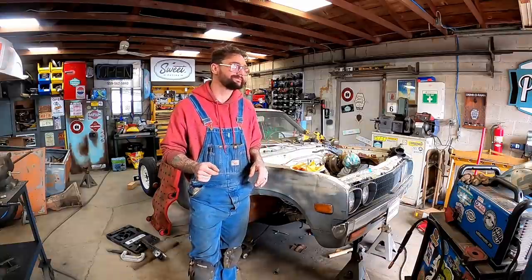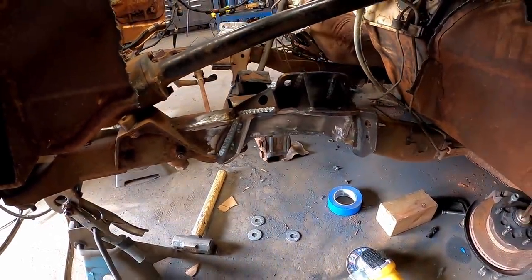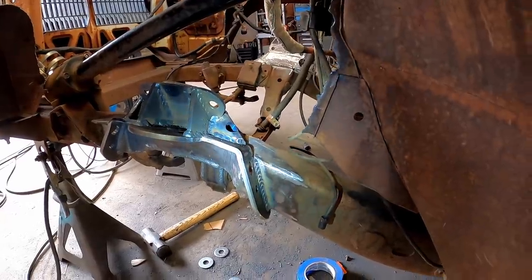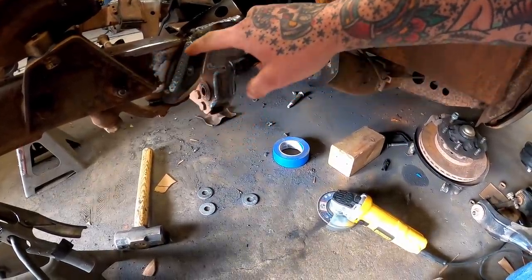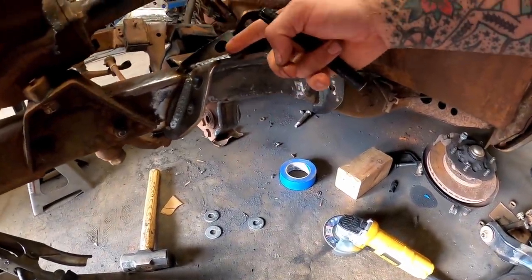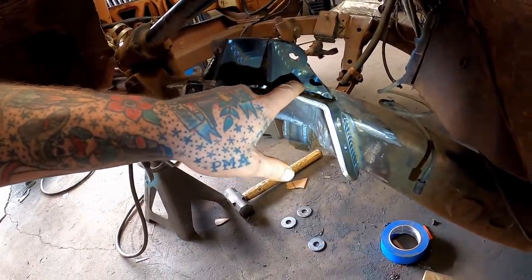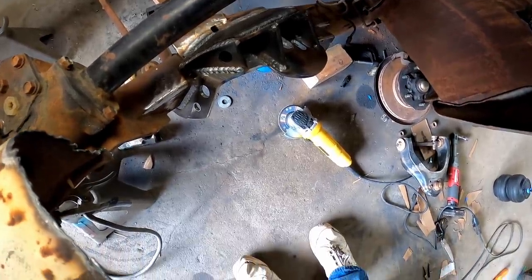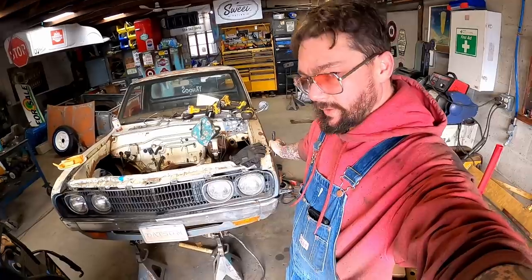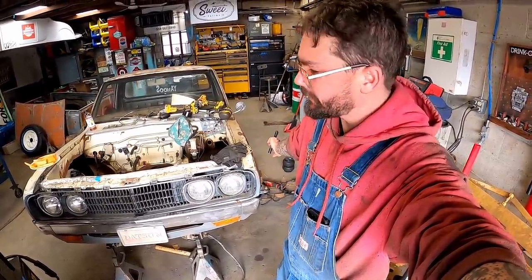And I did. Boy, I did. So here's the new gusseted front end. She's gusseted on the backside too. So I added these that wrap from the bottom of the frame up to there. Of course, then I added a little corner piece there. Basically did the same thing over here. And y'all know good and well, some speed holes almost look as good as some New Balances. Couple of simple gussets turned into 4 hours of work later. I had her figured out.